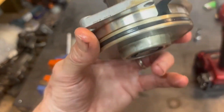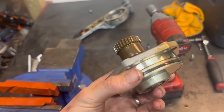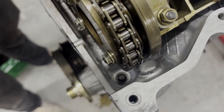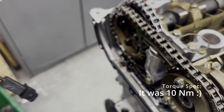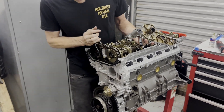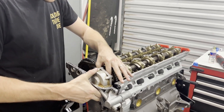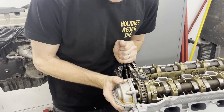In the future if we have leaks and stuff like that we can replace this outer seal, but otherwise it's a rebuilt vanos unit that took no time at all. They are incredibly hard to find and they stretch really easily, so do not buck them up — they're like 10 newton meters. This guy goes all the way to the right — you see here — set this in and turn this gear until we're trying to start the bolt in. There it is.